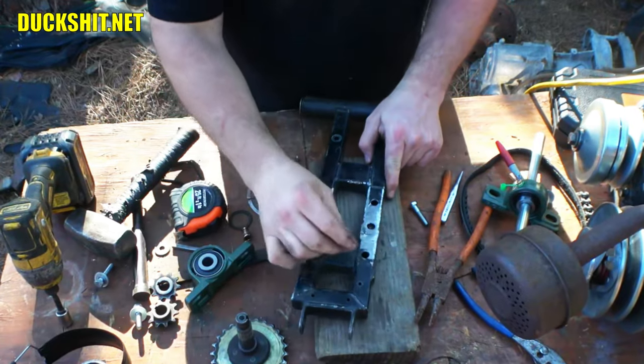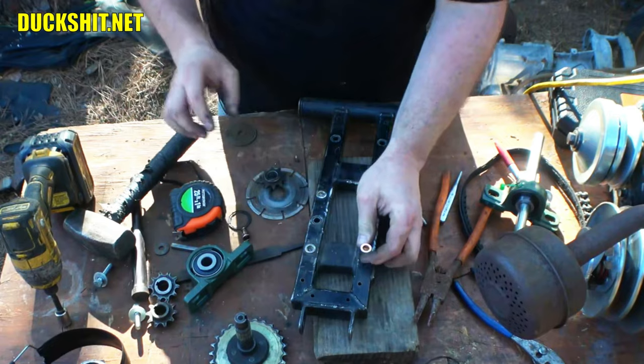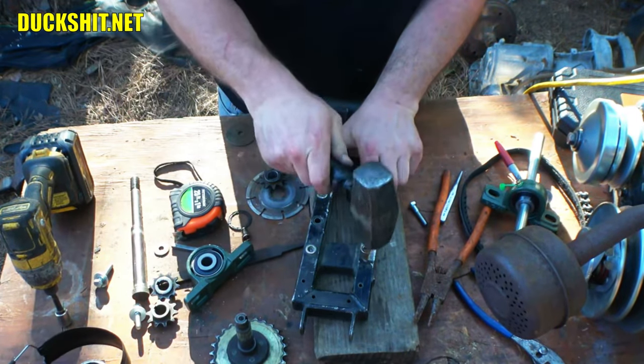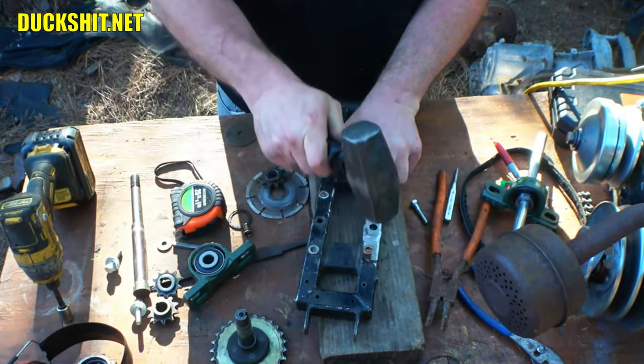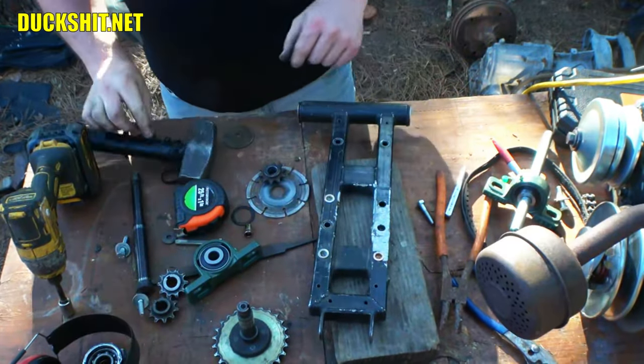We'll be right back. All right, right here we got our riv nut. We're going to place it in the hole we drilled. The hole is the same size as the drill bit, so it's going to be a little snug. So I like to just tap it in there. Once it goes, and it's set.